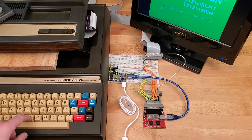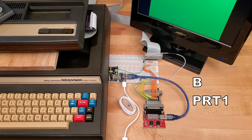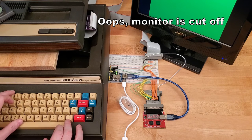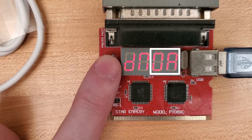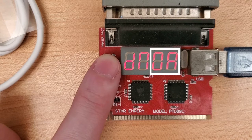To start sending our own data, first we type in B to enter BASIC. Next, the user types in PRT1. This tells the keyboard component to send text from programs simultaneously to both the screen and to the printer. When the user types this in, it sends a single byte of 0A. A byte of 0A means line feed to a printer, so the printer would advance the paper up one line to start the next line of printing.